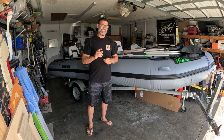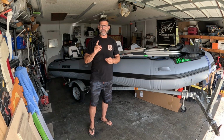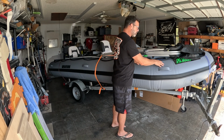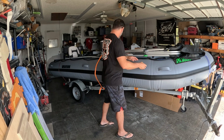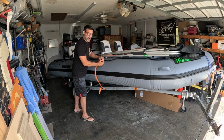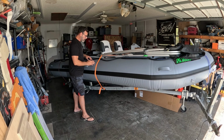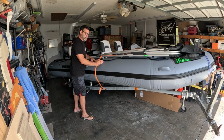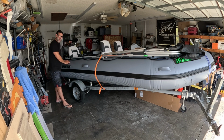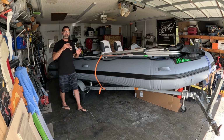Now what happens? You're out on the water. It's getting hot late in the day. Sun's directly above. That's a big problem. Things start getting really, really hot. The pressure of the front tube, it's going to release through that valve. So what happens for the rear? As the pressure goes down in the front, that bellow starts going forward. Lesser pressure up front than rear. It's giving that extra cubic foot of volume space to offset that pressure in that rearward tube. Same thing will go for the one behind it if we're talking about the 488, and everything will be just fine.